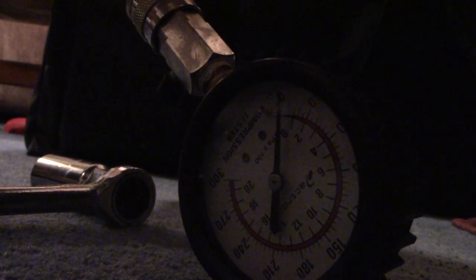The plug is oil-soaked — that could be from just me running it or trying to kick it over to make sure there was nothing left in it. Get the compression gauge hooked up. Now I'm going to start kicking it over with the throttle wide open and you're going to see that needle rise up after a few strokes. These have to be done on a warm engine with an open throttle — we're kind of breaking the law doing it on a cold engine. But that's okay for this demonstration — it's not going to start, don't worry about that.